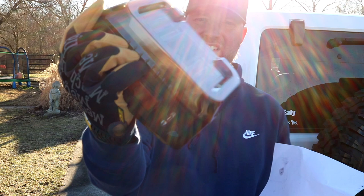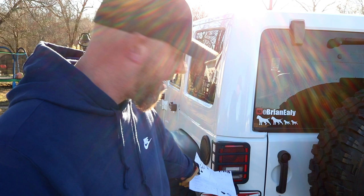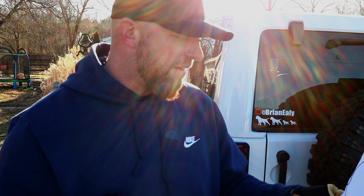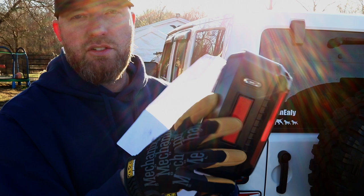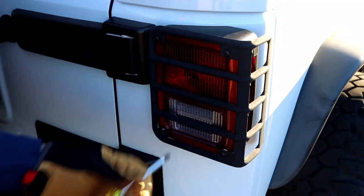Sure is pretty. These feature a 20-watt LED backup light. 20-watt LED is equivalent to about 2500 lumens, compared to that little 4-watt incandescent bulb that's on there now. Built-in plug-and-play installation. They're 6000K color, they've got a 50,000-hour lifespan. They're DOT certified, and they have a breather hole in the back — so they're not just some cheap made thing that's going to overheat on you. They're built well, they feel solid. Time to put them on.